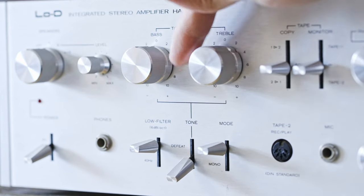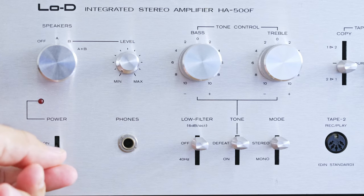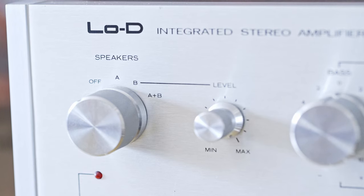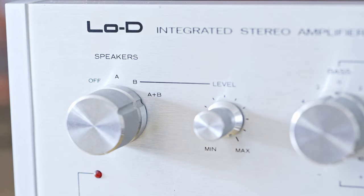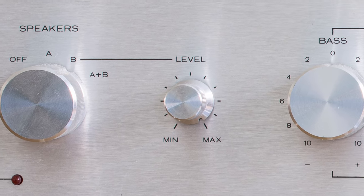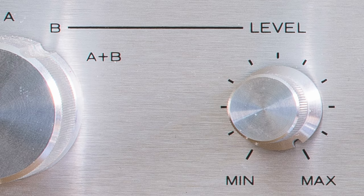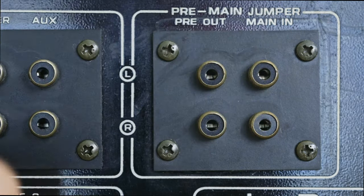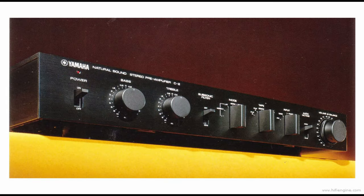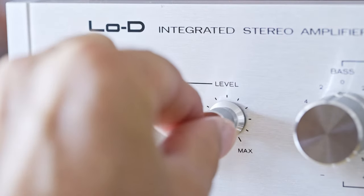She's solidly built — all the buttons, knobs and levers are firm, nothing feels loose or knackered even after so many years. The power lever is quite self-explanatory, just push it up, wait for the relay to click, and you're ready to go. You can connect up to two pairs of loudspeakers and switch between A channel, B channel, or both. What's quite interesting is a function that works only when speakers are connected to the B channel. The amplifier allows you to bypass the preamp, switching the amp to a sort of power amplifier mode. Since the volume knob is part of the preamp, you can't use it. You may use some external preamp, or control the volume from your source. And if you can't do either, there's a level knob to lower the volume when the preamp is disabled.